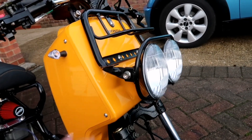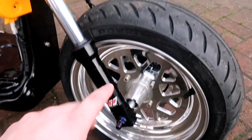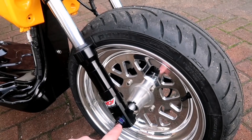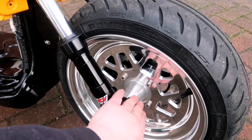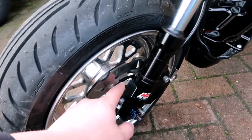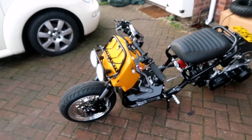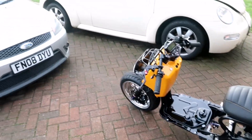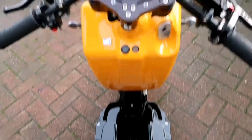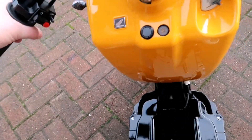The grey headlight has all been restored. Indicators are a nice little touch — they're not invasive. We've got the Altical front wheel with Michelin Power Pure tyres front and back, NCY slammed forks with a titanium neochrome axle. Ruck Shop hub as well, using the standard triple tree which we just refreshed, and then we've got the 220mm rotor, the Trailtech pickup routing up from there. She's a really nice bike to sit on — very comfortable, and we've got the lowered kickstand so it has a nice lean to it.